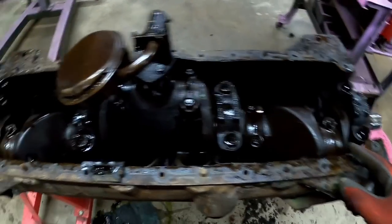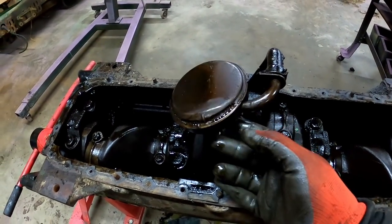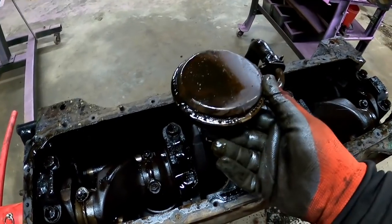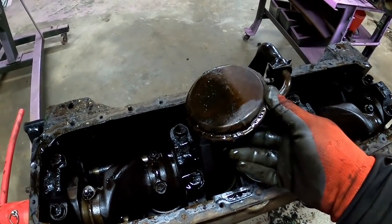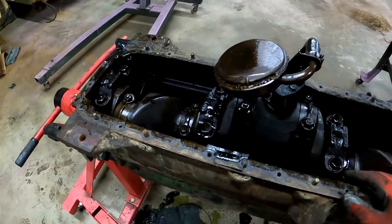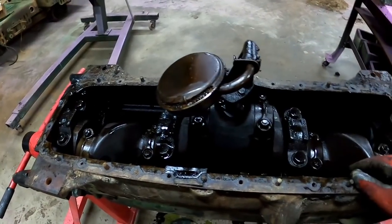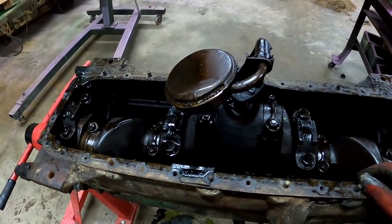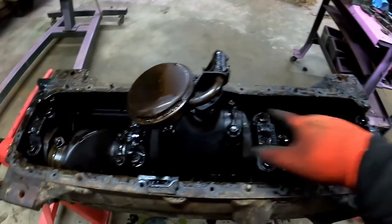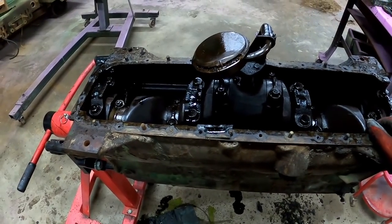This is the Floto screen oil pump — it's upside down at the moment. The idea was there's an air chamber on the top, and this suction would float on top of the oil so if your oil got a little low it could still get it. The theory was it was picking up cleaner oil, since all the crud settles to the bottom. This idea came from back when tractors had either no oil filter or bypass oil filters, where only a little bit of the oil got filtered. This tractor and newer stuff is all full filtration.